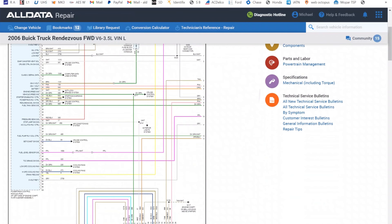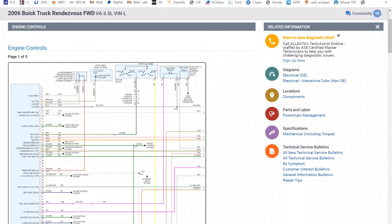I got a test light connected to the battery negative and here's the coil. He's going to crank it and I'm going to see if I get spark. Crank — stop. As you can see there's no spark. So now I'm going to check power to the coil.